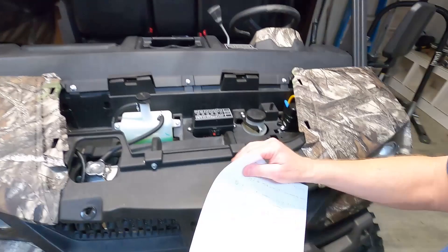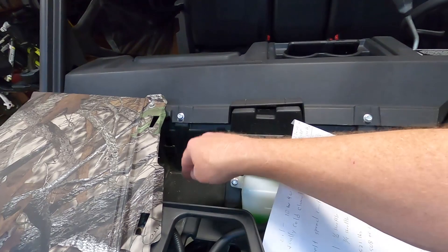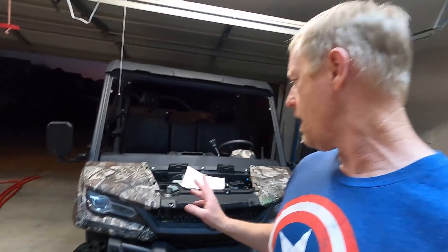If you're going to put an extra battery in here, there's a nice spot right here where one would fit. I don't know if I'm going to put my battery there or not — I'm going to add an extra battery for things like radio, lights, and other accessories. The oil that goes in here is 10W40 for most climates in the United States. If you live way up north you might want to think about 5W40. I live in Mississippi where it gets really hot in the summertime, so I'm going to run 10W40.